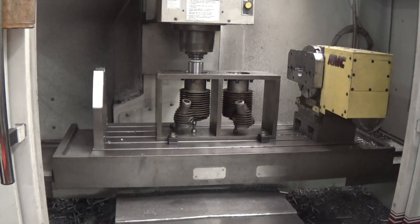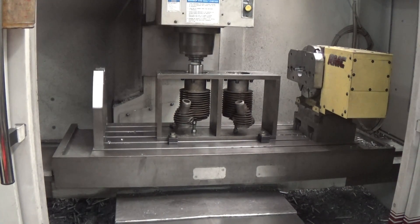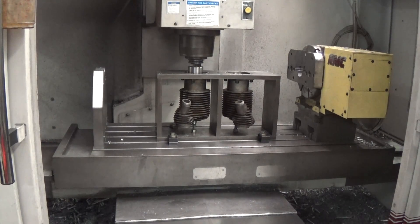At the bottom of the bore, the tool will face forward and then retract away from the cylinder before it pulls up out, so the cutter doesn't drag on the nicely bored surface.